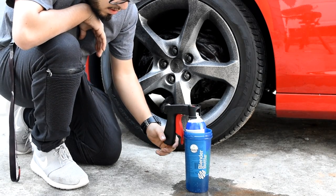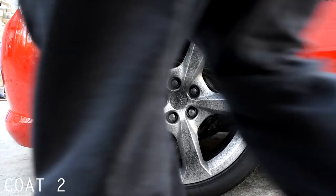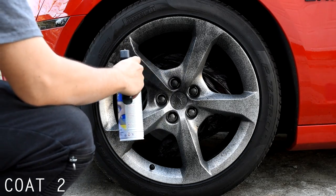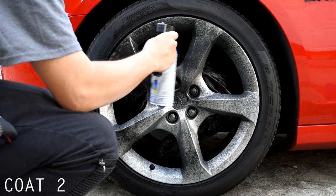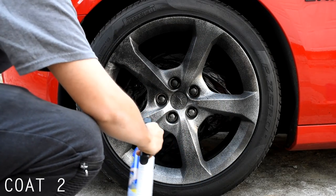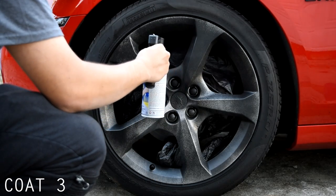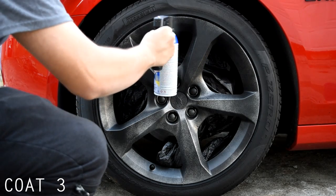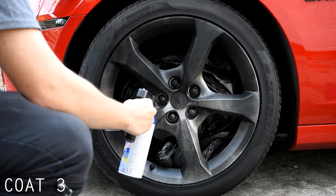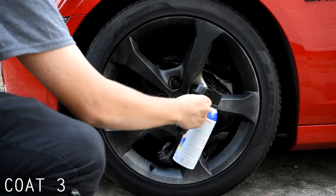We're just going to let it sit here for a couple of seconds or maybe a minute. Warming up the can has worked — we're going to add the second coat right here. As you can see, it's coming out more fluent and it's not coming out as spotty as the first coat. Now this is the third coat. When you're applying the plasti dip, you want to be about five or six inches away when you're spraying it so you can cover it enough and it'll come out even. The closer you get, the nastier of a look you get, so stay about five or six inches away.